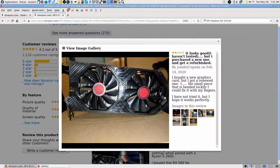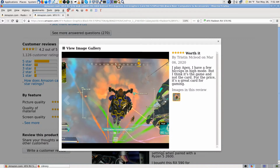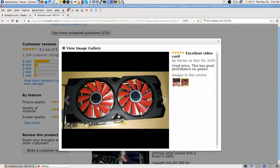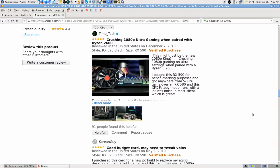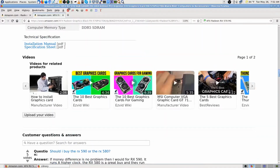I see a bunch of reviews where people say, oh, I can run it on a 250 watt power supply. And it does have some software built into the driver, but it may only be in the Windows driver, that you can turn back the power if you're having trouble with it overdoing your power supply. Your system can't handle it. I wouldn't buy it depending on that though, myself.